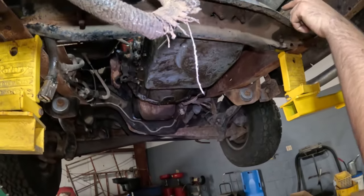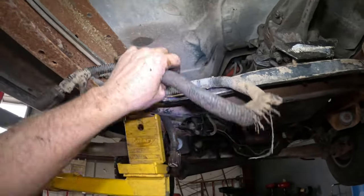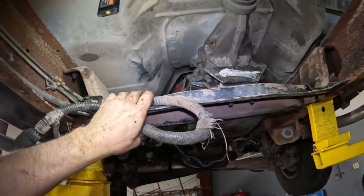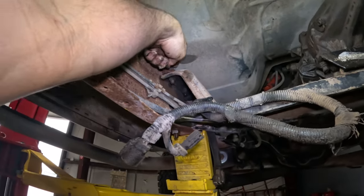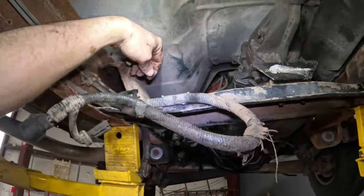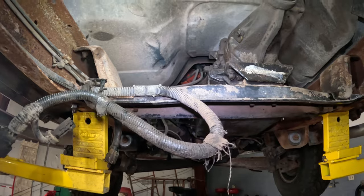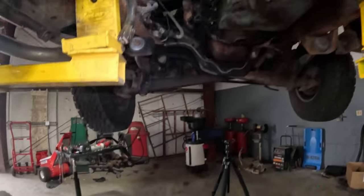So taking this thing off? Yeah. Well, dismount that. I think we have the transmission jack over here. I could be wrong. Gilbert was doing a transmission this week. These are going to be an issue because the bolts come down from the top. So these could just be loosened and then these taken out, we might be able to shimmy the bottom. Wrong size. Okay, I'll pull the torque converter bolts out. Do it.